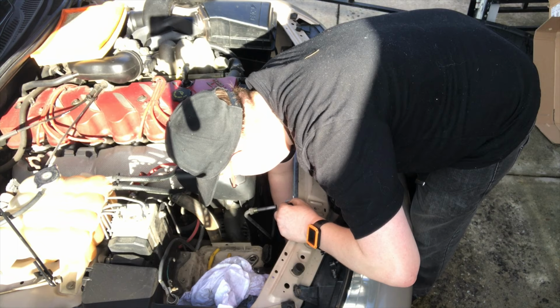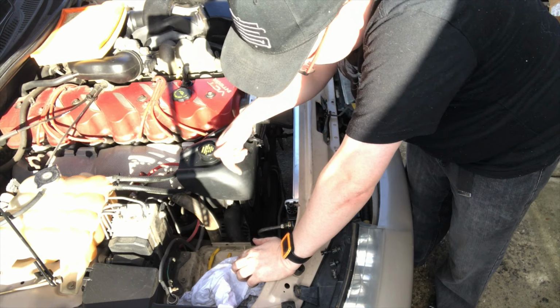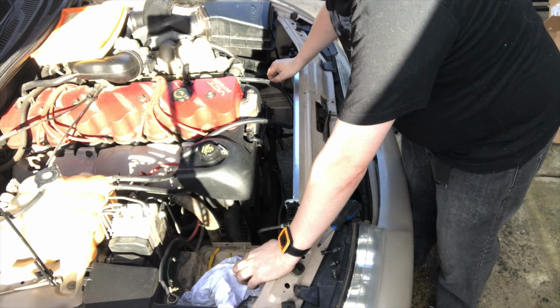Now I'm going to connect my first transmission line. Second, slip that in there too. Thirdly, pop the other lines back onto the radiator and slip the fan back in and make sure I plug that all back in on the same harness that it's locked into. Alright, I'm going to time lapse this now so that I get this done quicker.